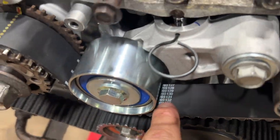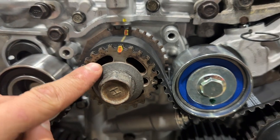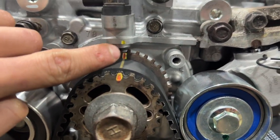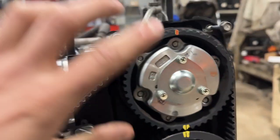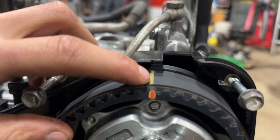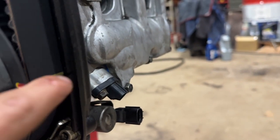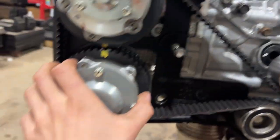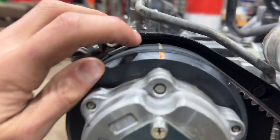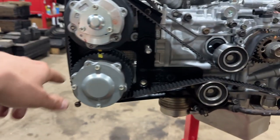We got the timing belt on, letters facing us, everything lined up. The timing belt has its own marks - the dotted one lines up with the crank gear, the notches line up with the marking on the oil pump, and the cams have a line on the cam gear that lines up with the line from the timing belt, which then lines up with the mark on the back timing cover. The two cams line up with the double notch down below. On this side, same thing - got the double notches lined up, the notch on top lined up with the timing belt and the notch on the back timing cover. Both sides all set.